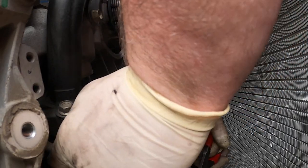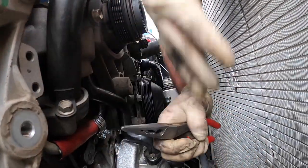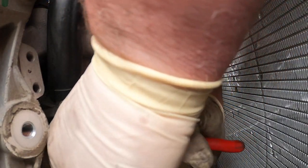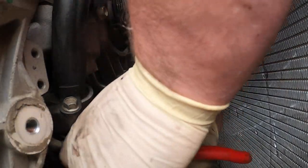And we're gonna go ahead and slide the clamps over. And then you're gonna go back here, and I usually just pry on it. Sometimes this thing's kind of bent too. You can kind of see. Let's get on the hose, put around the hose, my needle nose, and just push it. Let's walk it. You want to try not to grab the hose too much.